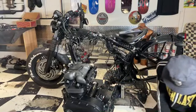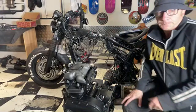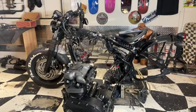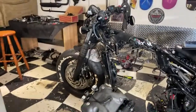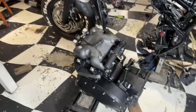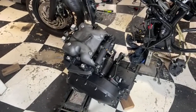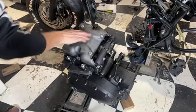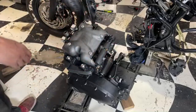Under there. Let's bring you guys, or you guy, however many people are watching, to there. And we're now going to take the head off of it. Might take my fuel rail off first so that doesn't get damaged.